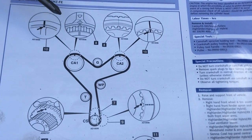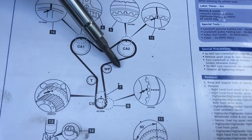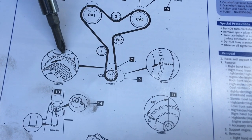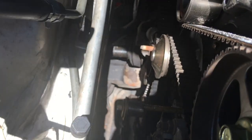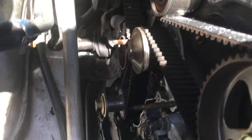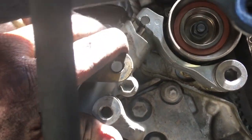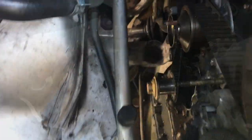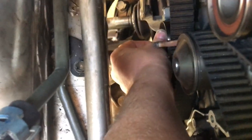I apologize I don't have a paint marker to show it to you clearly, but the diagram that comes with the kit and the diagrams available online are very clear. So here's another illustration — the back washer behind the sprocket, you can see the dimple and the little dimple on the engine block lined up. I was able to take out that lower bracket without having to jack the engine up at all — a new one for me. Maybe it's pulling the water pump out when I'll have to do it. Now it's time to remove the timing belt tensioner — take this bolt out, squeeze this down to access the bolt behind it, which relieves tension from the tensioner bearing.